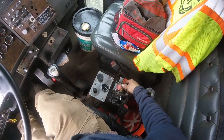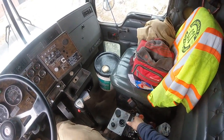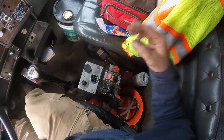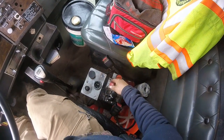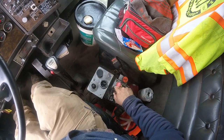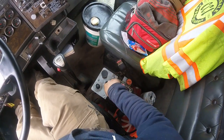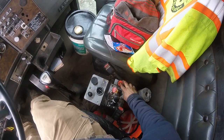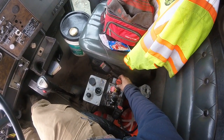I just backed up. So you got in the center here between the seats — some trucks are different, some are mounted on the dash. This one here, the PTO is down here. So this is your dump lever: up, down. This is the engager PTO. And this one over here, the orange one, is your tailgate.